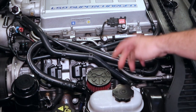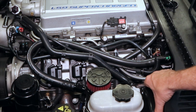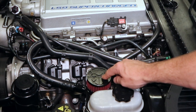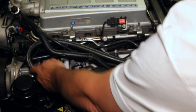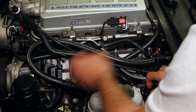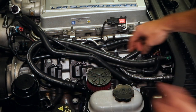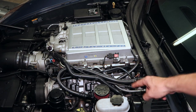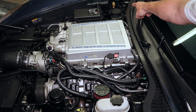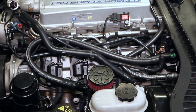As you can see, we've got the catch can mounted here — it's actually mounted on the same mount as the master cylinder and brake booster. We're going to be taking it off real quick before emptying it, because of the straight connection and the loop it had to create to go back into the valve cover. Instead we're going to use that 120-degree fitting to re-angle this and have a straight pipe go in there. I'm also going to replace it with silicone line. That's the before — I'm going to cut to it; I won't show the work, but I'll show you all the after.